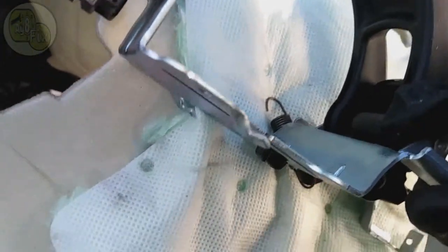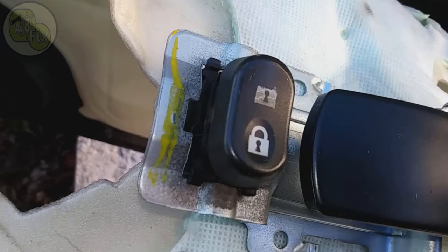You can see where it actually broke and that piece is no longer there. To finish this job, you simply want to take this lock switch and remove it from this bracket, then keep it to the side. When you get the new lock piece, you're going to reattach this bracket to the lock piece, then do everything in reverse order — put your clips back on, slide this back into place, screw everything down, and put everything back how you got it.